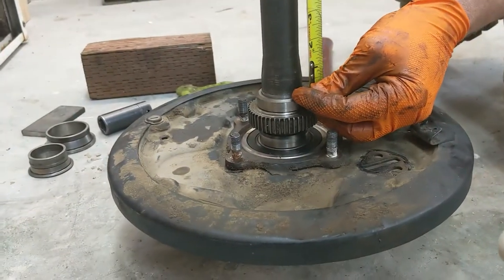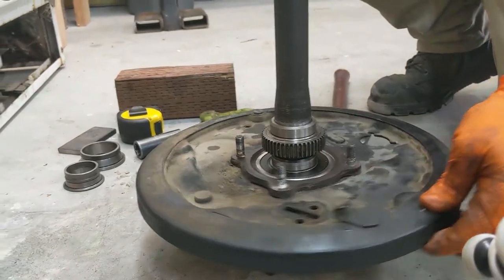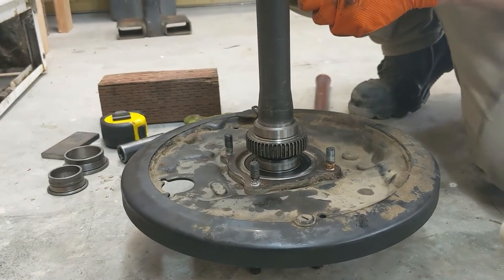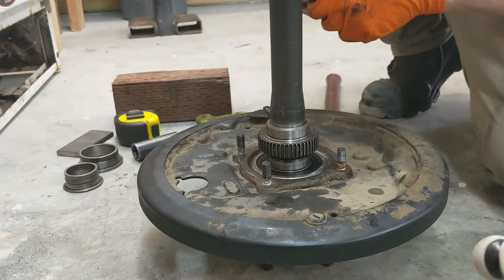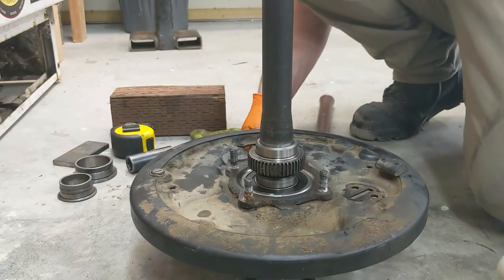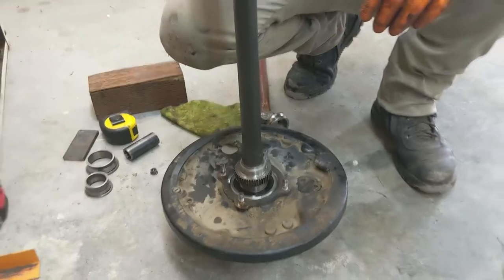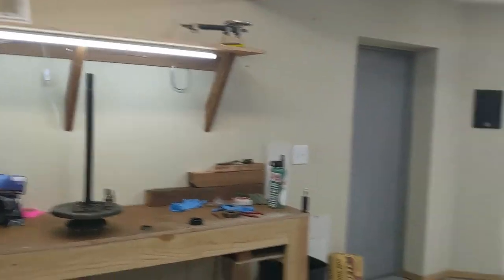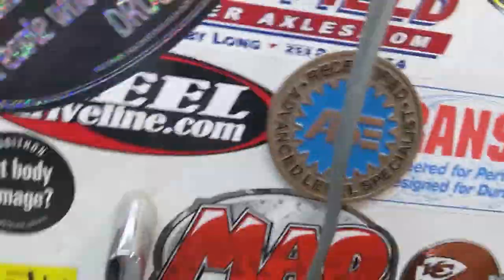You've got a tiny bit of leeway. If you're in doubt, install the axle into the housing with a little grease, turn it, pull it, and it'll show you the reveal mark on the sealing surface. Because of the way that the ABS housings are designed, it can be kind of a pain to get that seal in there and get it to sit down right and not leak, so a seal driver is a good idea. Always use OE axle seals for those. Great gravy — much better using a press and tool than dropping it on the ground a thousand times. Thank you Daniel for coming out and letting us film. That wraps up another episode of Snail Racing — please like and subscribe.